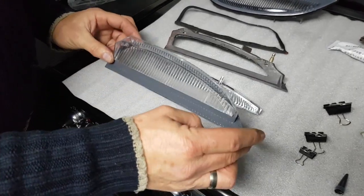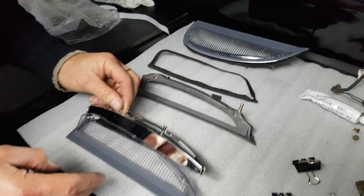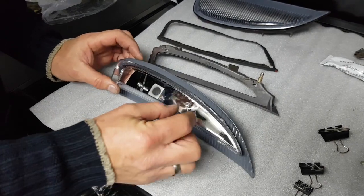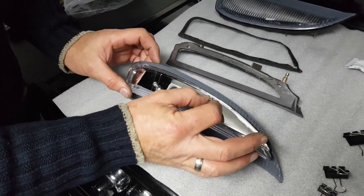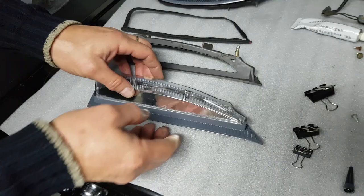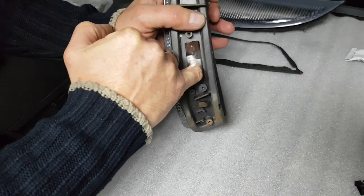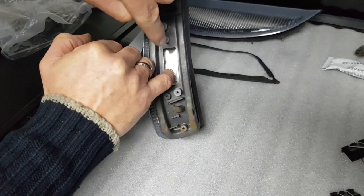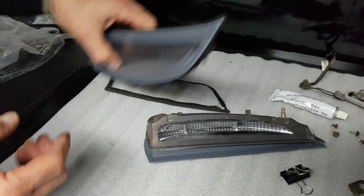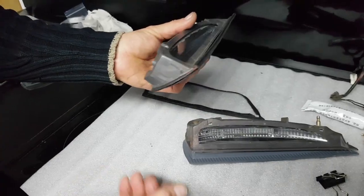Remember, if you're putting back together a lens with the chrome backing, you need to put the chrome backing in before you put on your rubber seal and bituminous rubber. The reason is this lens is almost the same size and it'll get stuck to the rubber as you put it in. So if you put that in first, then put on all the other parts and assemble it, you'll find that once you push it together you can easily reach into the hole, pull the chrome backing up to put your screws in, and everything goes back together as normal. Finally, with both lenses, don't forget to put on all your metalwork and cables. Thanks for watching the video.